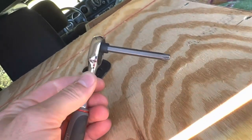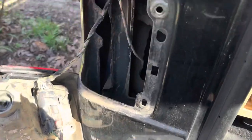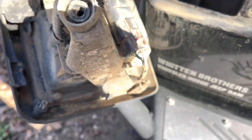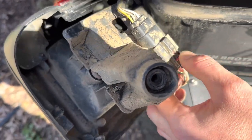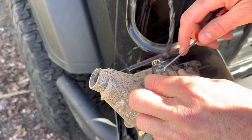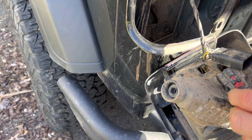The T40 is right there. It's basically a plastic bolt with a spring on it that holds tension on the assembly itself. You can see that end of the plastic bolt — we just left it in place. It goes into that part of the tail light, then there's the wiring harness, so it really pops out super easy. In order to break the harness apart, you just pull the safety clip — use a pick to get up underneath the little red tab and pull it back, then there's another tab underneath that you lift up on, and then wiggle it apart.